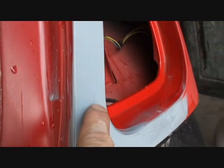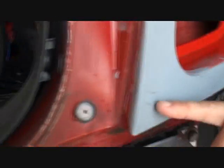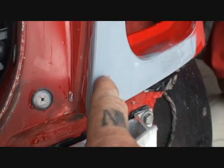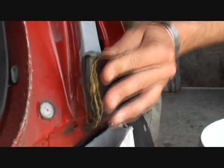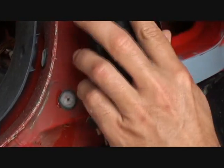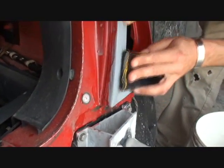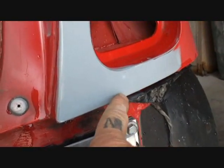You can see there's still a deep scratch. Rich has to be very cautious not to break through the primer. It's very important — do not break through the primer. What we're trying to do here is get rid of the deep scratches and the imperfections. A little more pressure on that — right down in the corner there. That's exactly where we want it. It's looking good. We've got a few little imperfections and I'm sure Rich will get those out as he goes.